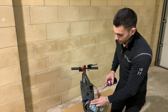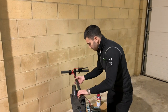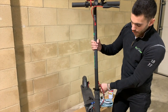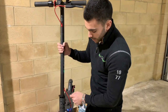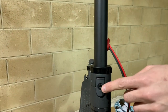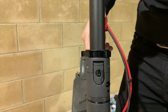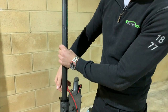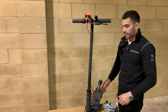Any excess WD-40 — if there isn't an issue — just wipe it up with a cloth afterwards. If you need to adjust anything on the scooter and feel that the rear lever of the folding mechanism is a bit soft, there's an allen key bolt here you just want to tighten. You really only need to tighten it a quarter of a turn, half a turn — if that. Just test it every time. You don't want it too stiff where you're fighting to get the lever up — you want it so it's a nice, firm, positive fold up, but not too stiff.